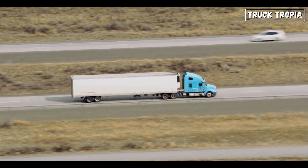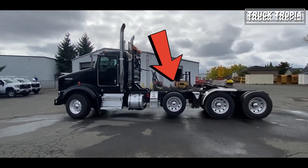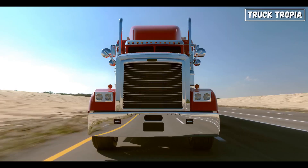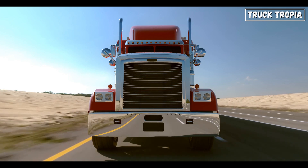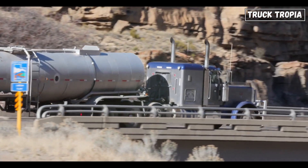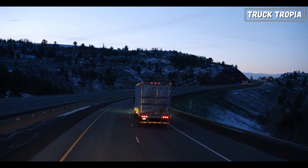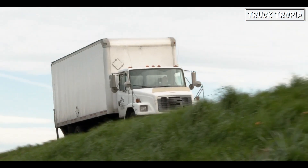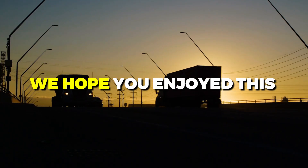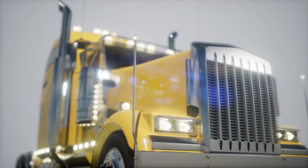Lift axles are commonly used in long-haul trucks, dump trucks, and construction vehicles. So why don't the tires of some trucks touch the ground? Because some trucks have lift axles that allow an axle to be raised when it's not needed, saving fuel and reducing tire wear when the truck is driving empty or with light loads. When the truck needs to carry more weight, the axles can be lowered to reduce ground pressure, legally carry more weight while complying with regulations, and improve road grip and safety. Therefore, an additional lift axle can be a versatile aid for a truck that drives with variable loads. We hope you enjoyed this and learned something new. Remember to subscribe to the channel for more content about trucks and other road beasts. See you soon!